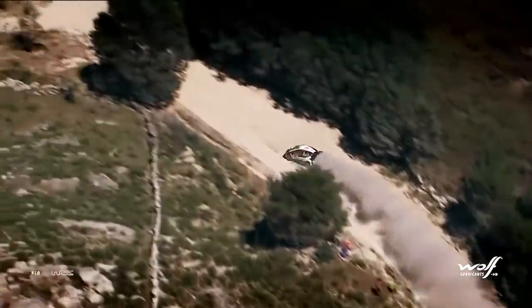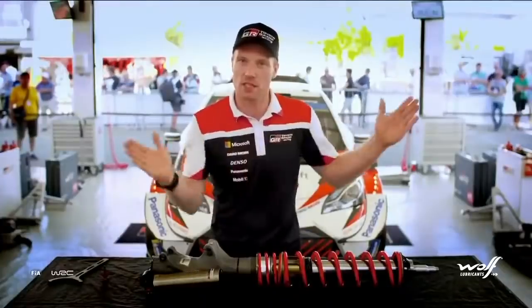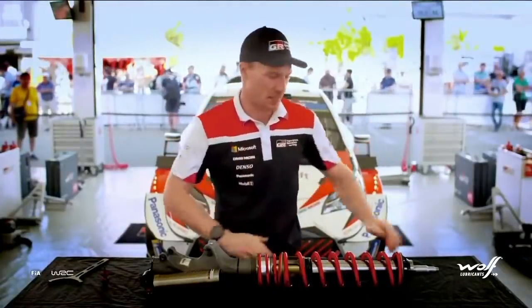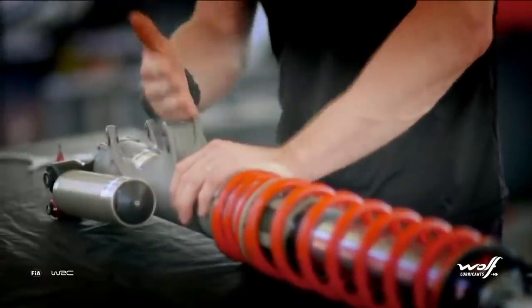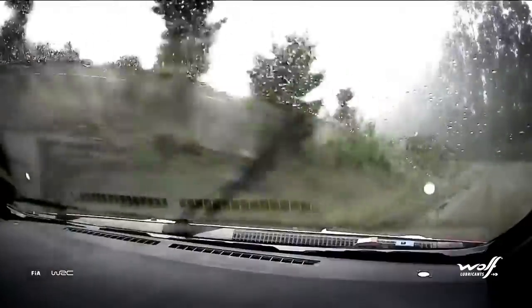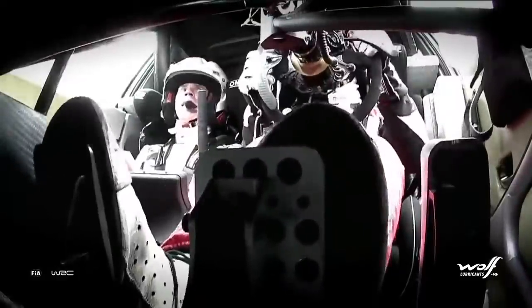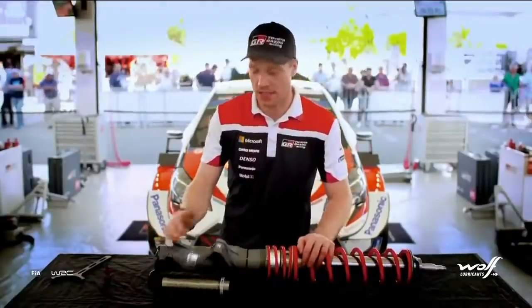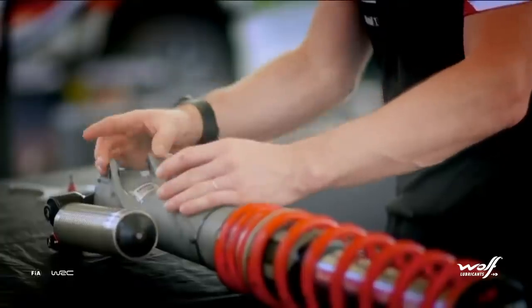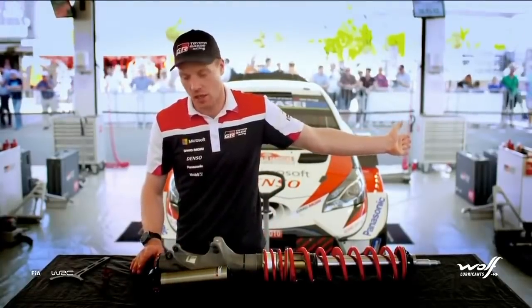I tried to keep going. With every braking and every bump, it just compressed all the time like this — hammering, hammering, hammering — and then you operate the top mount. This is the fitting to the upright. You've seen me in Rally Chile when I retired. There was too much load coming to the damper body and the upright, and actually this piece cut out from the damper. And after that, if you don't have these fixing points, the car goes anywhere — the wheels will be completely open or loose. You can't steer the car anymore.